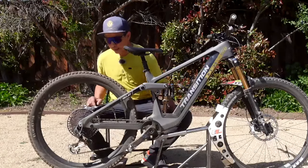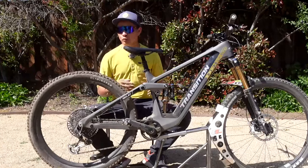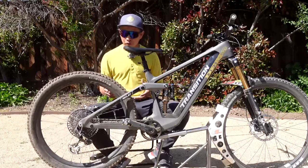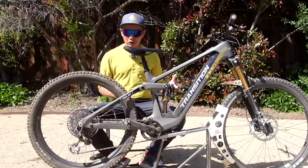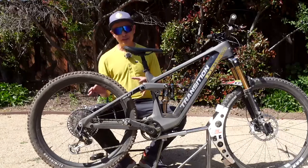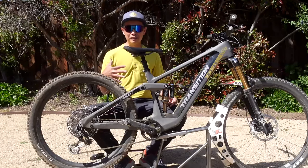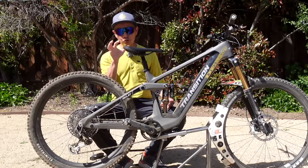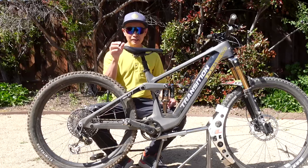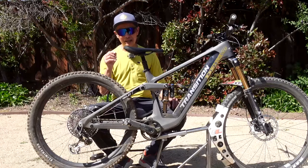It's still better to get a GX or NX system, and really my preference is Shimano SLX or XT. As it wears down it starts to make noise too, so there's wear and tear involved. Is this going to be more durable than XO or GX? Because it doesn't force the shift, it definitely is — but it's not made for e-bikes. There are just too many speeds, everything's too thin. What I really want for an e-bike is 10 or 9 speeds so you have room to make the cassette and chain way thicker.